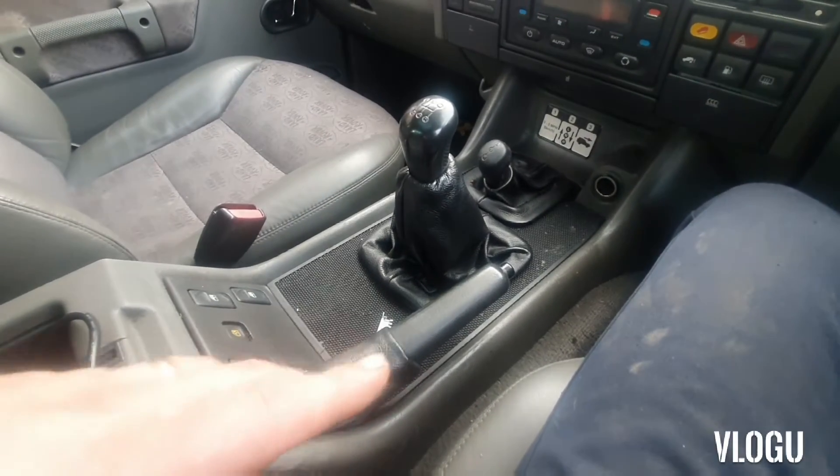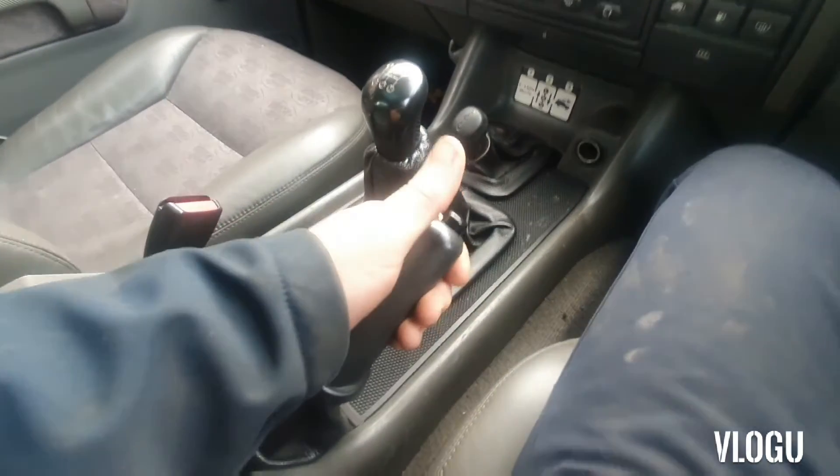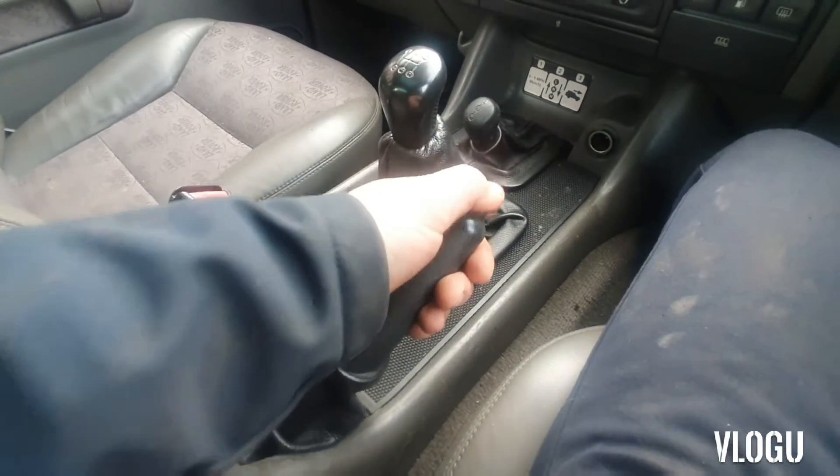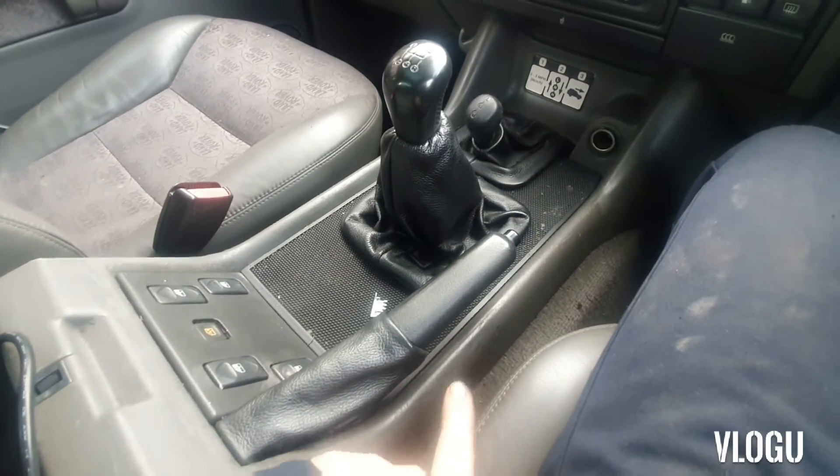I'm in the Discovery 2 — we've got a problem with it not starting, and we've found that it cuts out if you let the handbrake off. So we're going to get it up in the air and see if that's affecting the earth. What we think the problem might be is the earth strap, so we're going to find the earth strap to the engine and make sure that's nice and clean.